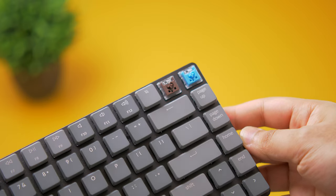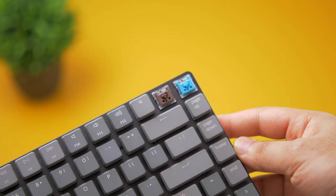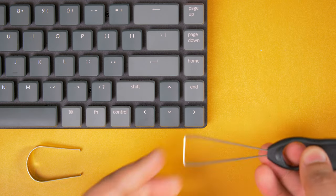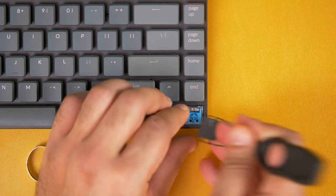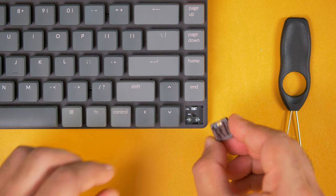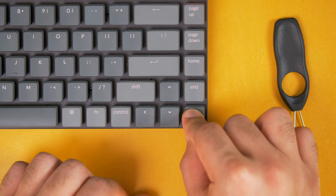All optical switches have 1.1mm of travel — just 0.1mm more than the MacBook Magic Keyboard, for reference. Exchanging switches is really easy. In the box you get a keycap puller to remove caps without damaging them, and a switch puller. Press the top and bottom of the switch and pull it out gently, then grab the new switch, place it in the square hole, and push it down evenly. Finally, place the cap back on and you're done.